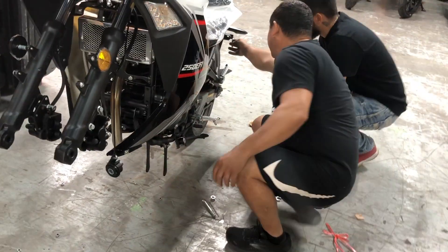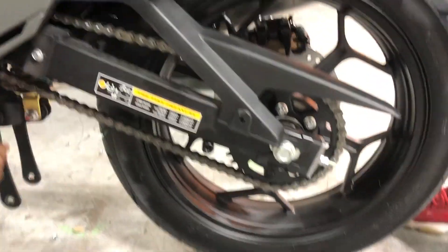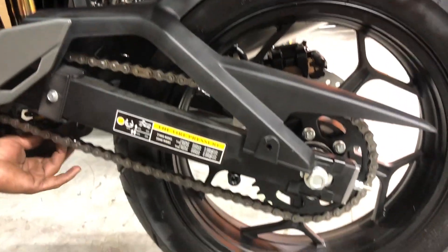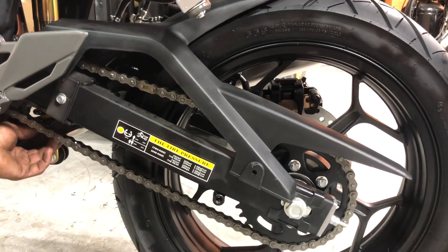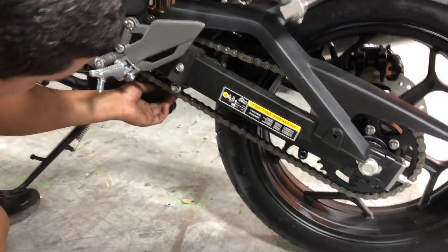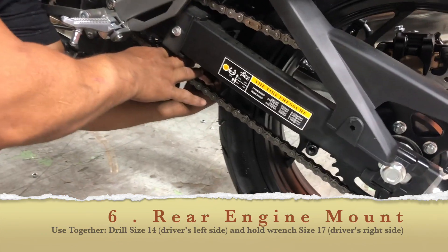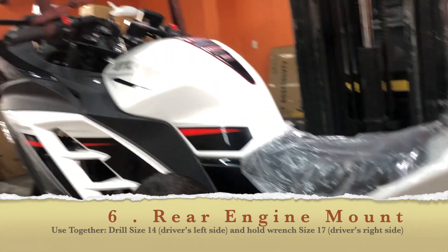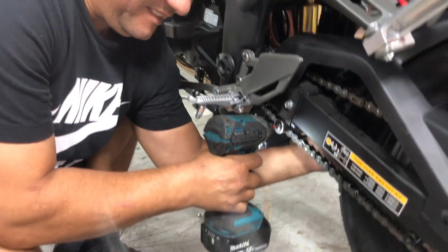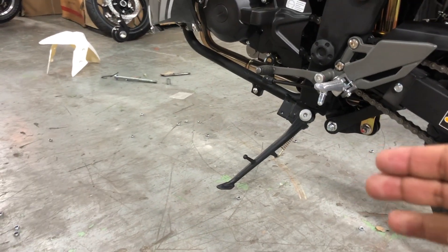So here's something you might need help with — to grab onto that bike right there as he puts it on. So that's for the back end frame to be connected fully, and then you can put the rear shock bolt in place. That was size 22. Size 14 and 17 — 14 in the front on the left side of the vehicle, and 17 on the right side. So left side 14, right side 17.